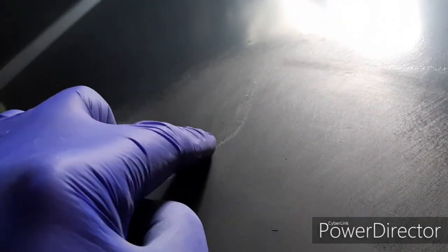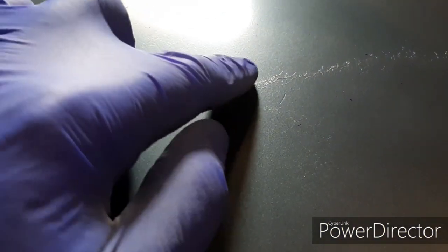The way I've got around it is using a scotch pad — I think it's 360 — I don't know what grit that refers to in sandpaper, but just going over it lightly to sand it flat so I can't feel the wrinkles at all. You can see it's raised, so it's just getting it nice and flat, then properly cleaning and degreasing it, wiping it down, letting it dry, and tacking it off.